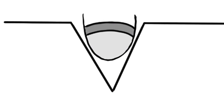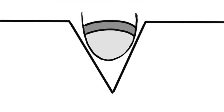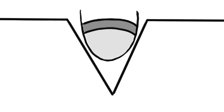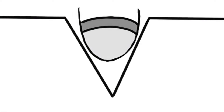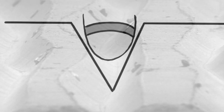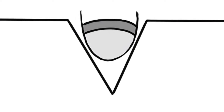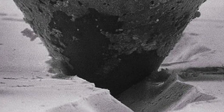Let's start with the spherical or conical stylus. As the name implies, the conical stylus is rounded at the tip instead of coming to a point. Its rounded shape gives it a larger radius, and as a result, it won't trace as deep into the grooves. Think of the groove as a valley, the bottom of which collects dust and imperfections. The conical stylus avoids this, which means less hiss and less pops.